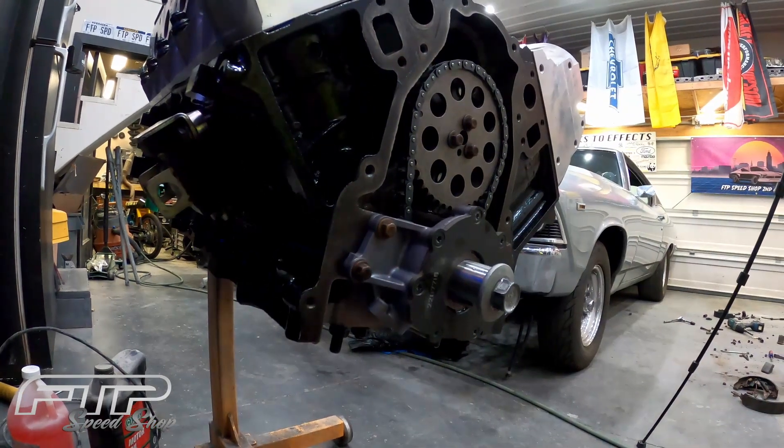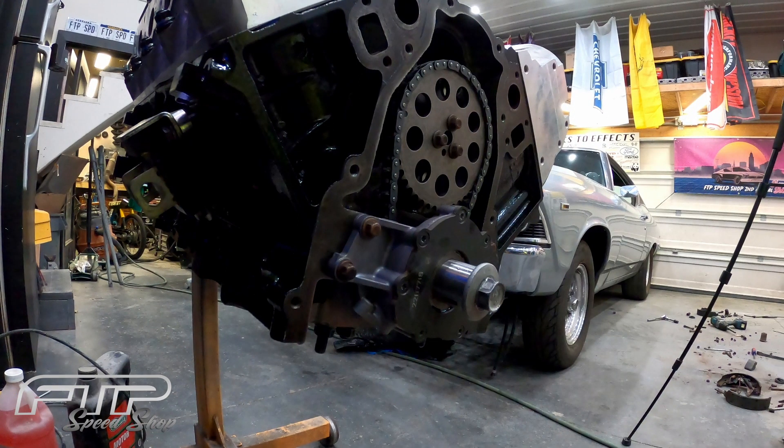That's going to be the install process I use for installing an LS-based oil pump and making sure we get it shimmed properly so we don't have any interference issues — the pump gears and drives wearing on the housing. With the first pump we didn't shim it quite right and there was some wear on the pump housing, so this method has worked perfectly for the last two pumps. If you have any questions leave them below, check out the next video where we get the pickup tube, oil pan, and timing cover installed. Don't forget to like, share, subscribe, check out our Amazon affiliate links, and hit up ftpspeedshop.com for merch.